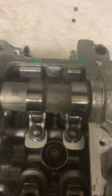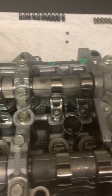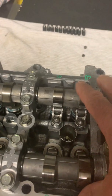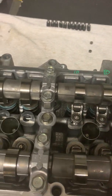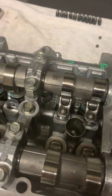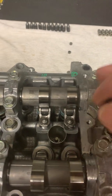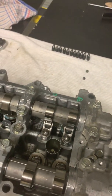This is with the original pivots in place, to demonstrate how the bespoke pivot drops in. Generally the clearance should not have to be altered, but it's very important that clearances are set right. I'll pull the cam box off with the two camshafts, remove the rockers and the original pivots, and insert the bespoke pivots. This is all carried out before the rocker clip is inserted - you don't want to put the clip on, put it all together, and then check clearances. Get your clearances right first, and the last thing you do is install the rocker clip.